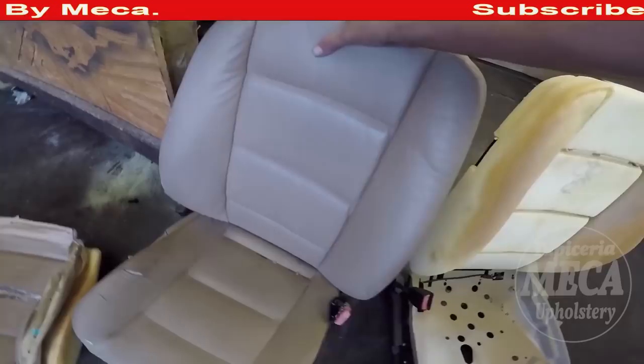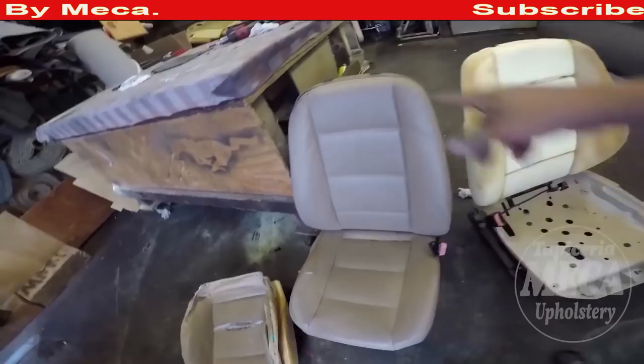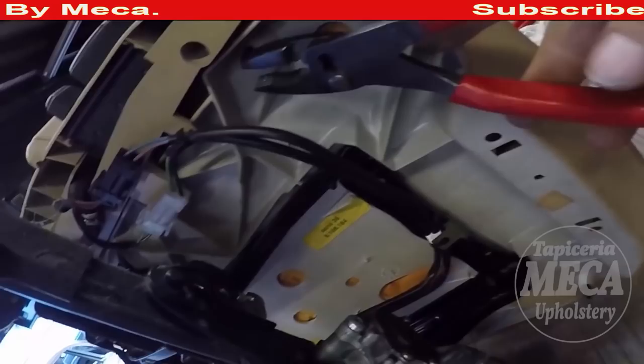When the old cover is leather, leather tends to shrink. So you have to correct the old cover first in case you're going to use it as a pattern. So make sure to correct it. If you are not going to use the cover, you are going to cut by the foam. Most of the time I do that, but this time I will use the old cover to cut the new one.